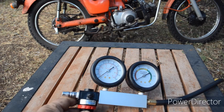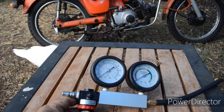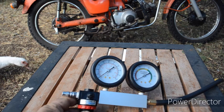What use is this tester? Well, in conjunction with a compression tester, if the compression tester gives a low reading, you can use this — just set it at a low setting, ignore the percentage gauge, and use the fittings to add compressed air into your cylinder and fault find where the air is leaking from. In my case, air was leaking into the crankcase past the cylinder. There's a chance it could have been the cylinder head gasket leaking into the cam tunnel, but I don't think so — I think it's the rings and the piston.